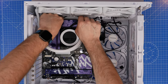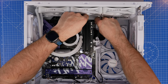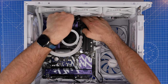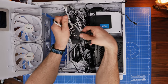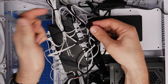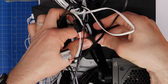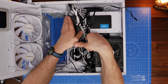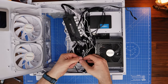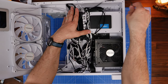Then apply thermal paste — this cooler normally comes with pre-applied paste, but I'm using Arctic paste since I've used this cooler before. Apply a thin, even coverage across the IHS, then secure the pump down on top with the cables pointing upward. Put the four thumbscrews through to the standoffs installed earlier and tighten them one by one — use a screwdriver to make sure they're fully tight without over-tightening, otherwise your CPU may run hot. The Kraken's cables include a fan power connection for the three radiator fans, a USB connection for the pump display, SATA power, and a cable for the AIO pump header or CPU fan connector on the motherboard.